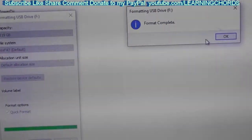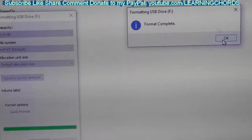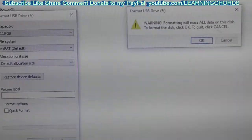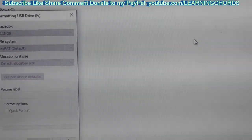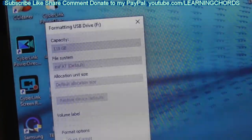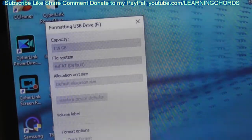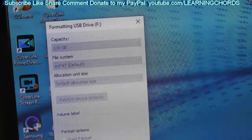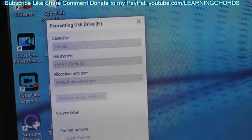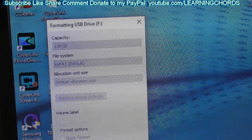Quick format complete, which took seconds, which kind of worries me. I want to do that again, but I'm going to take off the quick format. I want to do a full format on this and then plug it into the camera and see what happens. It's probably going to take a little bit of time — 128GB — but it's on a PC so it should go quick. If this doesn't work, I'll take a brand new SD card and find out how they format it when they sell it. I definitely know the problem is that I'm going over 32GB and they don't support that, and obviously their camera is not capable of formatting properly, so it likely messed up the SD card in the formatting process.